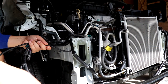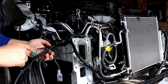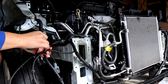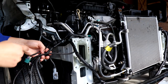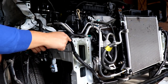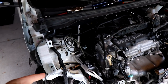I went ahead off-camera and repaired this wiring harness. You guys might remember this corner — since this is where the major impact was in the accident, it was indeed damaged. There were one or two pieces here that I cut directly from the donor car and spliced right in place, so we've got basically a clean, brand new harness implanted in. Anywhere you see this fabric electrical tape — that's what you see typically on German cars — I use it on repaired areas so I can go back and identify exactly where I did the repairs. This should be finished; we're almost done with this car once I take care of this damage here in the corner.